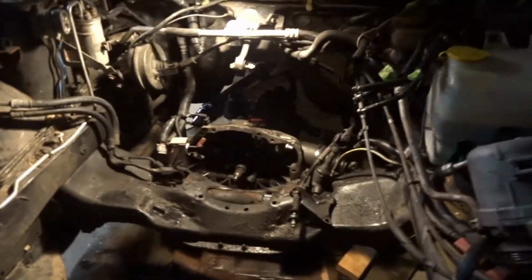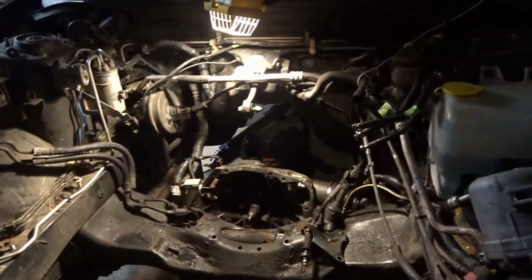But the transmission, the whole tunnel, is just covered in gear oil. And I know it's gear oil because it's slightly yellow and it's fresher. And it doesn't smell like oil. So I imagine something happened with the transmission. Videos don't really do it justice. Wow, my hair looks terrible. It's all greasy and full of rust flakes. And I was hoping to have it driving before this weekend. That's obviously not gonna happen.